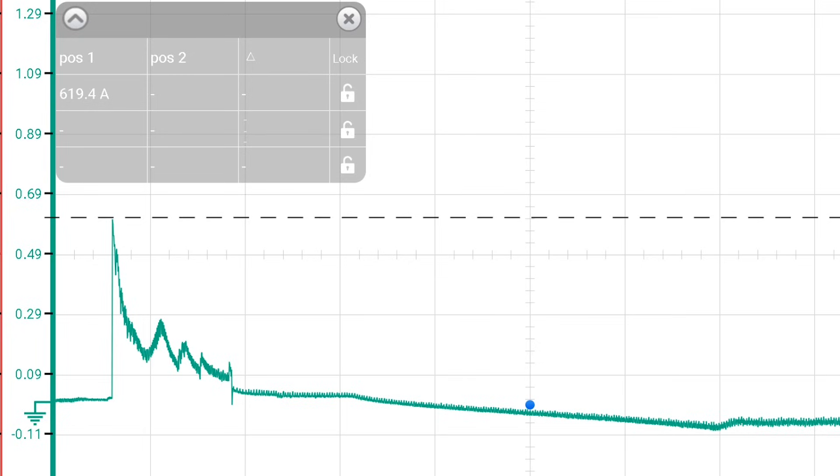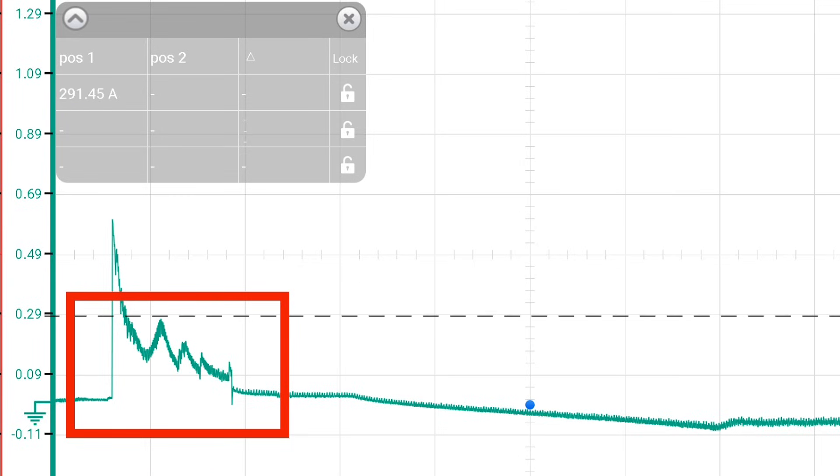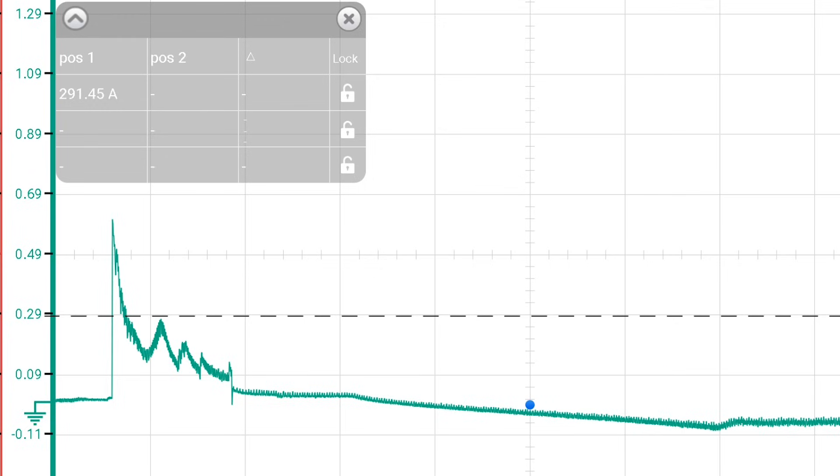When we move a little bit further to the right, you see these little peaks and valleys — that's the engine turning over. What you're seeing here is the impact of each cylinder on current draw as it goes through top dead center of its compression stroke. A good healthy cylinder with a lot of compression is going to be harder to push through TDC than one with no compression, and we're seeing that extra current demand that the healthy cylinders are requiring. This particular part of the pattern can be a very useful diagnostic tool to help compare one cylinder against the others — it's called a relative compression test, and you can find more about it right here on this channel.